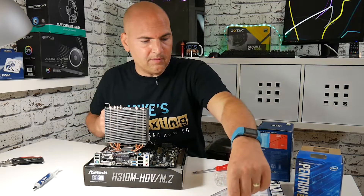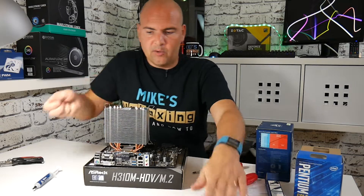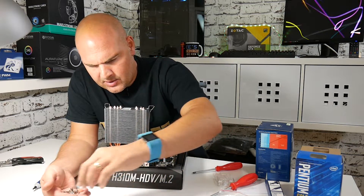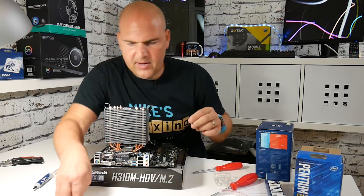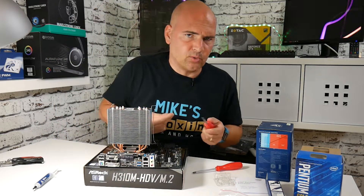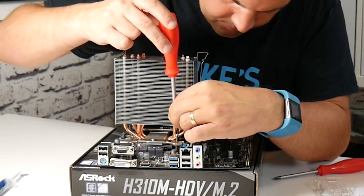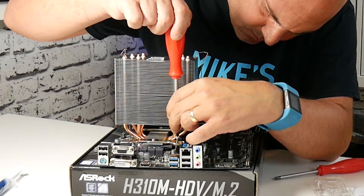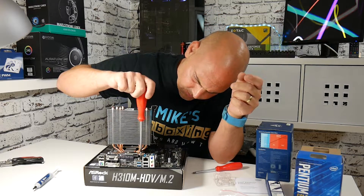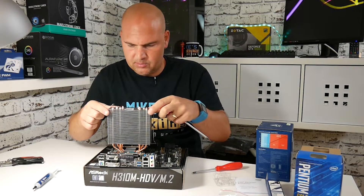When you've got the CPU cooler on top, line it up with the holes by visually looking down through. Now we have to use one of the sets of screws — there are three sets in the baggie: one for AM4, one for 2011, and one for Intel. The Intel one, if I remember rightly, is the one with the finer thread. My suggestion would be to only put the screws in just so they're almost about to pinch — tighten them down, take off all the slack just until the screw makes contact with the base, then move on to the next one. That way if you need any adjustment you've still got a little bit of wiggle room.